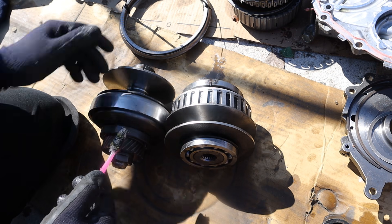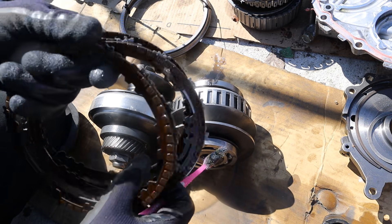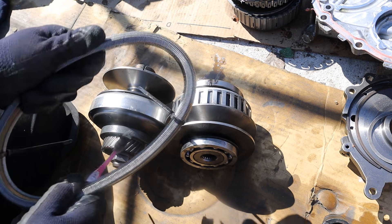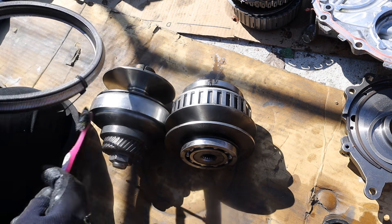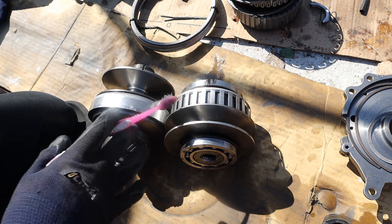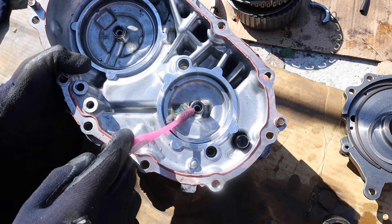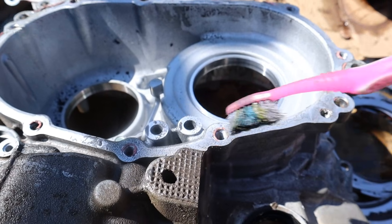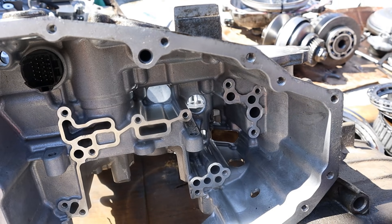Here's another CVT belt taken apart from a Nissan Murano video — you can see it's a bunch of small little pieces that look like this in cross section, and they've got that cone angle on it that's going to match the cones on the variators. Now the going thing with CVTs is efficiency — in an automatic transmission you have all these friction clutches that cause a lot of drag. In the CVT you don't really have that drag, just this belt rotating, and also it's got an infinite number of gear ratios. Nowadays they've got 10-speed automatic transmissions, but CVTs are infinite-speed automatic transmissions and they can always keep the engine in their sweet spot for power. The variators are controlled hydraulically by adding oil in the center through two oil ports on the transmission casing, which lead up to ports that hook up to the valve body.